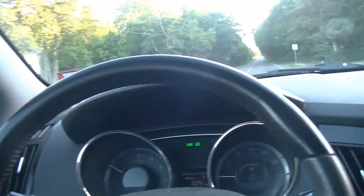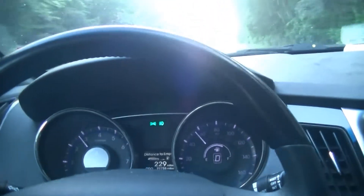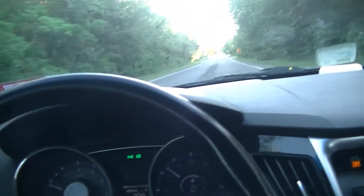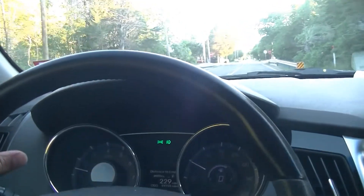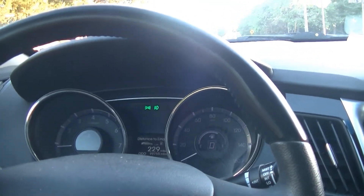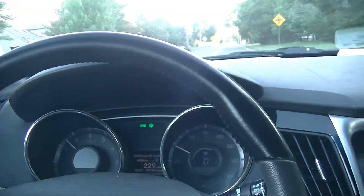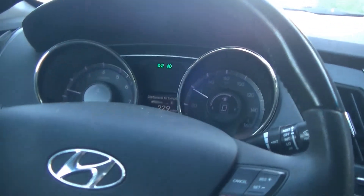Here we are in the Sonata. We're just going to pay attention to how this transmission shifts — we did just service it. We want to make sure it is shifting properly; we know the fluid is set to the correct level. If it's shifting hard or harsh, you're going to bring it back into your garage and reset the transmission adaptives. Sometimes if your fluid is really bad and you change it, it'll change the shift characteristics and you will need to recalibrate that. But I always like to take the car for a ride first, because if I don't need to do it I'm not going to — it can also change shift points. Everything with this car seems good, and I hope this video helps you. Please like, share, subscribe, and we'll see you next time.